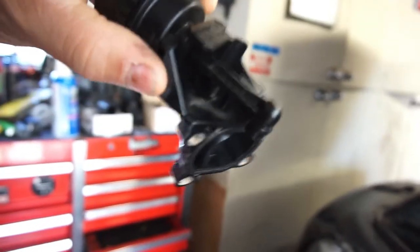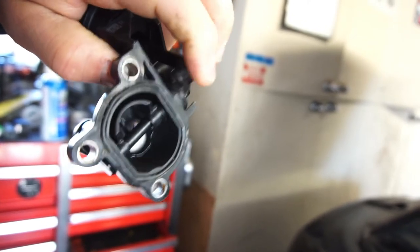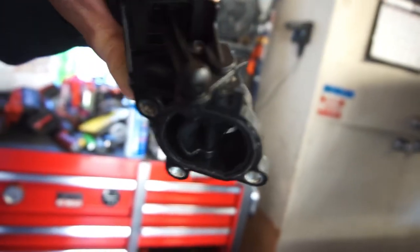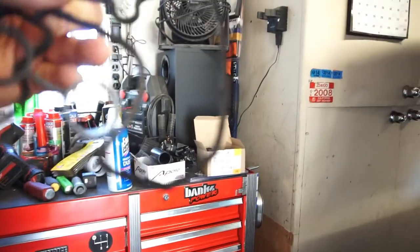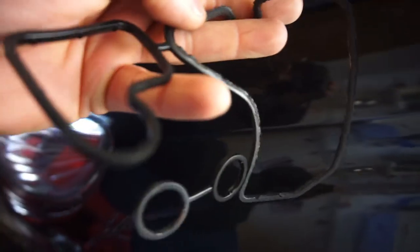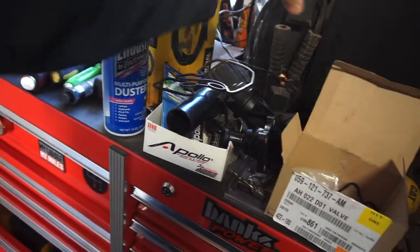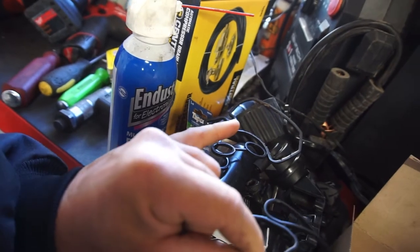I think the biggest issue is here, because coolant goes into here and comes out. I see a lot of coolant buildup right down in here, basically where this rod goes through for this arm. You can see where my finger is — there's crusty stuff — which I'm assuming is where it came out. So it's either coming out of there or it was coming out of this gasket, this o-ring. There's a lot of crust and buildup on this o-ring. This was on the bottom of the plate — it basically attaches to the engine. That attaches to the block underneath the oil cooler — there's a plate, then an o-ring.